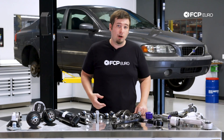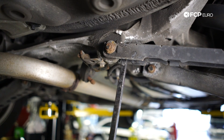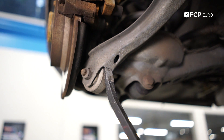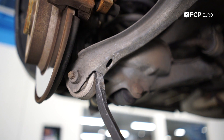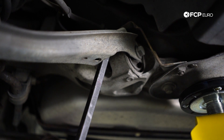Another thing that can go wrong with the rear end are the bushings, and the most common ones are the rear trailing arm bushings. In general, most Volvo P2 owners won't spend too much time with this, partly because they're all pressed in and the assemblies are fairly complicated. When the rear end bushings fail, you will get a similar wandering to a bad shock, but it won't be as pronounced. You also might get a little bit of extra understeer.